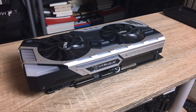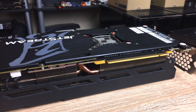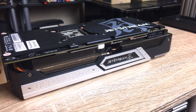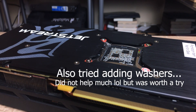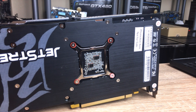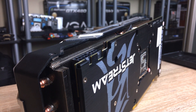This all bodes well for how the cooler performs in testing. The card has a backplate on the back with Jetstream branding, and it's actually a functional backplate — the memory and the VRMs are thermally padded onto the backplate itself, helping dissipate heat instead of trapping it. There are also cutouts for the GPU area so it doesn't trap heat. The card also has two power inputs: a 6-pin and an 8-pin, which is more than other 2060 Super graphics cards.